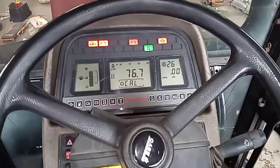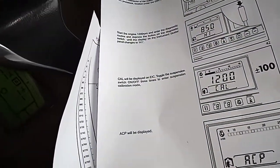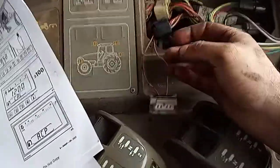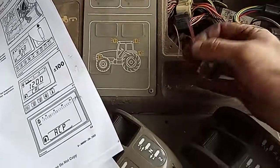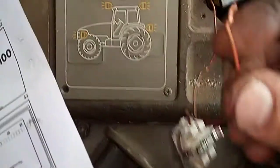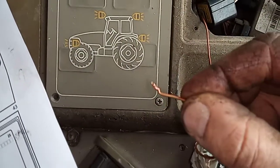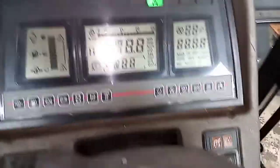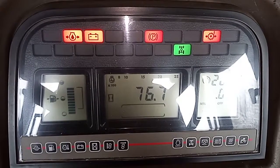It calibrated and my front suspension worked again. So that is the easy, no-cost, cheap diagnostic tool — part number 38000488. This is what it does, and this is what's costing all that money. I just remove the insulation, wrap the wire around, and plug it in — pin number seven and pin number eight. That is how you do it. And if you remove the circuit, turn the ignition off and turn it on again, it is out of the diagnostic system.